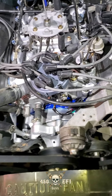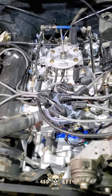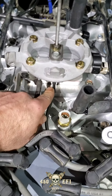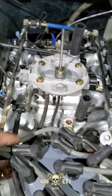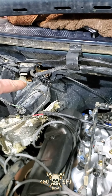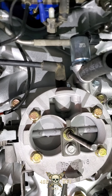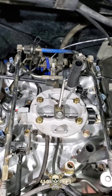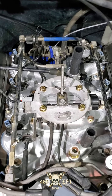As far as the vacuum tubes go, this engine is very cleaned up — it doesn't have any of the smog tubes, it's all been eliminated. They're still hanging in here just for the sake of the video. For your fuel pressure regulator, that will come over to the lower vacuum port on the throttle body, and then the bigger one here you're going to run back and up to your MAP sensor. On the back side here I have a brass — actually a shark bite fitting, which fits these really nicely — that'll go over to your PCV. That way you're dispersing any oil vapor across all eight cylinders. I don't like to ever run them into just one intake runner because you run the risk of coking or carboning up a cylinder.